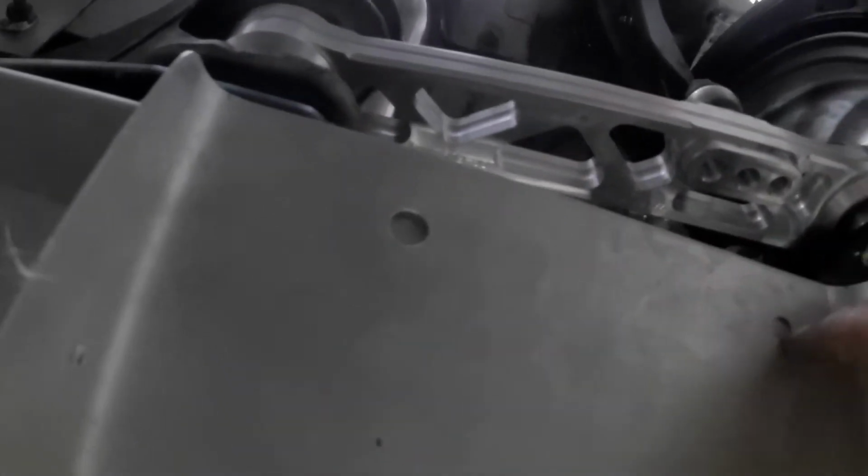Under here, this is the angle aluminum. I tuck the flat part inside here, and if you can see, this part is slid on the outside. So what I'm thinking about doing is marking this hole in this one, drilling and riv nutting it on both sides, and that'll hold that bottom up. And then eventually I'll pull off the angle aluminum again. I can bolt this up.